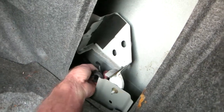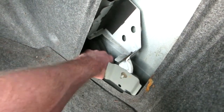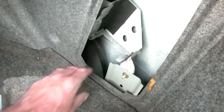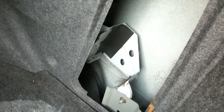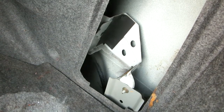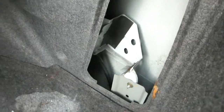Make sure the drain tube is hooked to the little fitting and then push it through that little hole. Blow through that big tube — make sure it's open. Make sure the little tube is open too. As I showed at the beginning of this video, that's what happened: the tube got blocked, the antenna motor filled up with water and of course shorted out, corroded, rusted away.